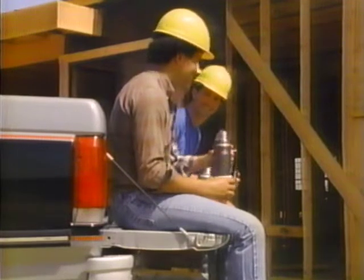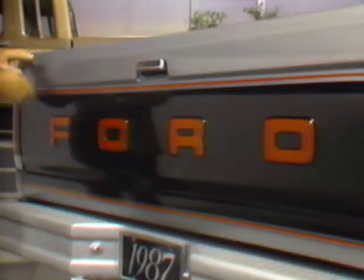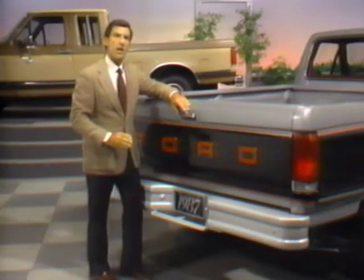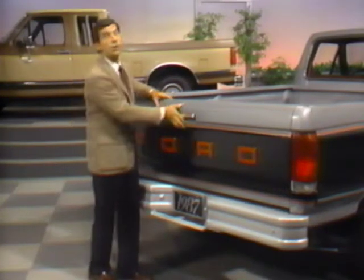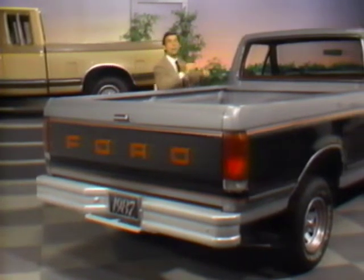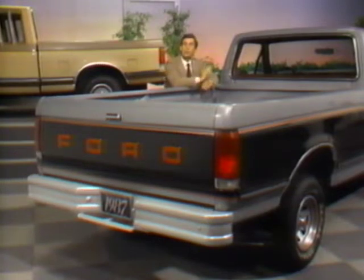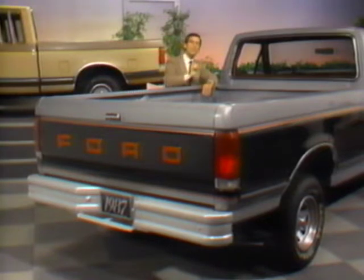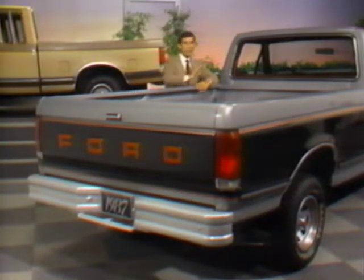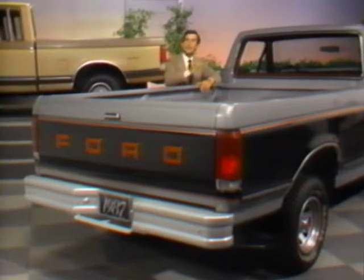For one thing, the tailgate has been beefed up in '87 to support heavier loading. The latch mechanism has been redesigned to be more door-like, so it's much easier to operate. And it's self-centering. Multi-leaf rear springs have also been recalibrated in '87 for improved riding comfort. And there have been important improvements in corrosion protection. In particular, the new F-Series body uses significantly more galvanized steel, including the entire pickup box and tailgate, as well as the front fenders, hood, cowl, and door